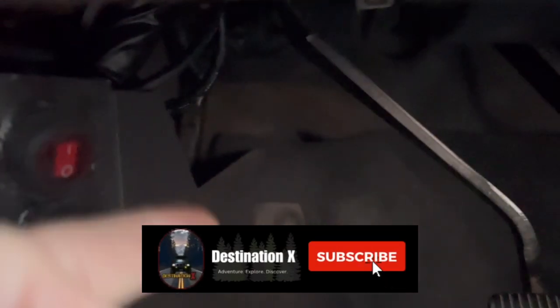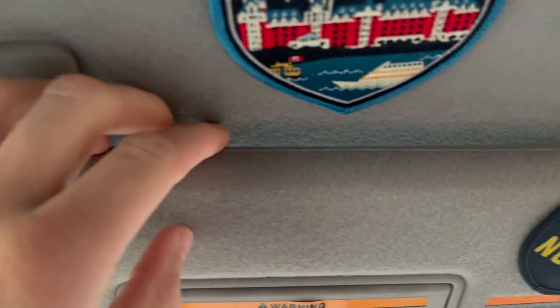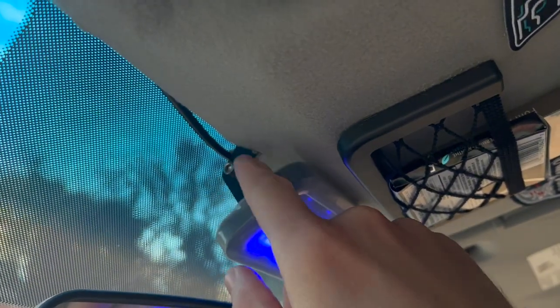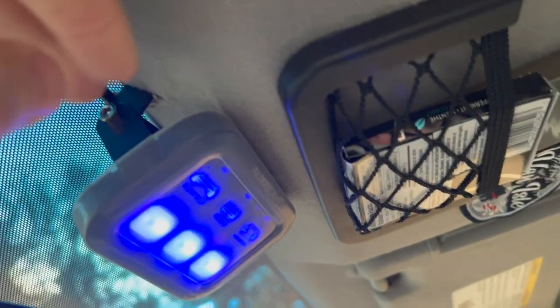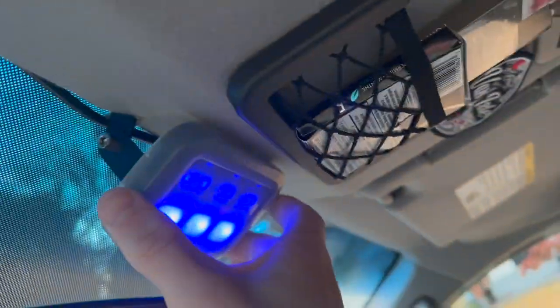To get this setup, the main power source came through the opening on the firewall on the driver's side. From there I took all the plastic out, just popped it all out along here and pushed the wire along, as well as along the roof up top — I slipped the wire right underneath there. Then instead of using the sticky pads, I use the little bracket that this comes with and tightened it into place. I took my Leatherman and cut a few little slits right in the interior roof of the Xterra just so it sits a bit better. I did put the sticky pad on the back of the mounting plate and pushed it up there and it's actually stayed pretty well.